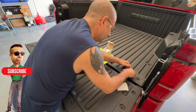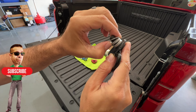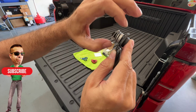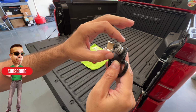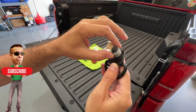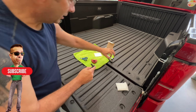I know that because I've had these on my other Tacomas, so you want to make sure you keep everything together, and it should all come out together, and it does, because there is a retaining nylon washer in here, but notice you have that retaining washer, you have a flat washer, another retaining type washer, and then you have a lock washer and then a, I'll call this an insert or a collar. So you wanna pull all that stuff off. Again, just keep it in the right order. You're gonna reuse all this stuff. The kit does come with a couple of new little nylon grabbers like these. Since I reused them, I did not have this, but you'll have a new one. I'm gonna reuse the old one. So you wanna go ahead and remove all of this stuff, again, keeping it in the same order. And let's set that aside.